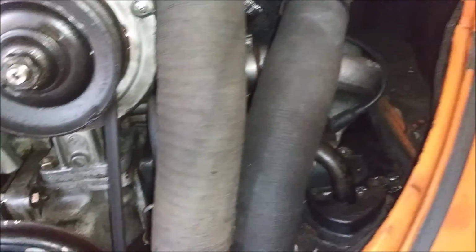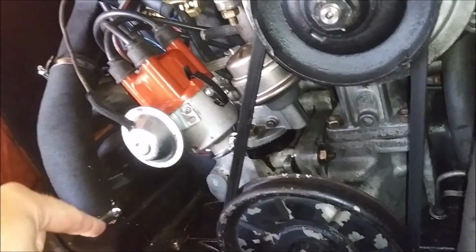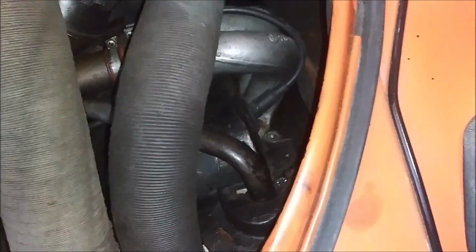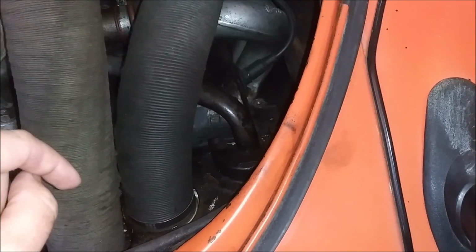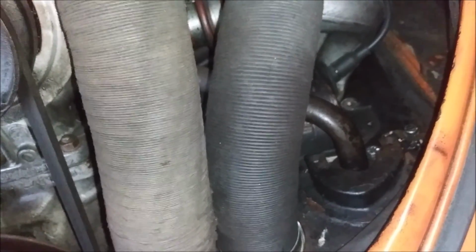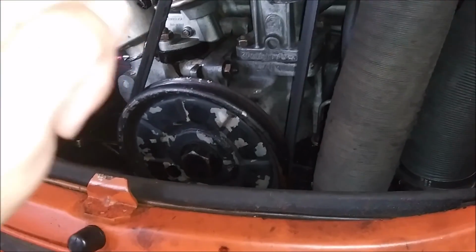So new muffler and additional parts successful. But like I was mentioning under there, after you get it kind of bolted up where it needs to go, that's when you're going to turn and adjust those parts before you get those bands on there, because everything's got to line up perfectly to come through this tin. If you don't have those things lined up properly before you start clamping the other things down, it's not going to fit. So you want to kind of turn those things, get them where they need to be about, then clamp everything down, and then you'll come back and readjust them one final time, and then you tighten those little sleeves.